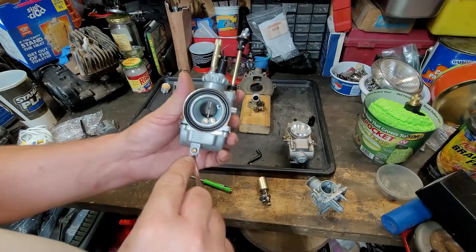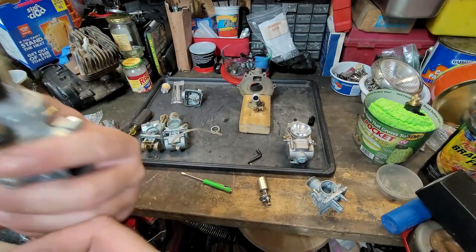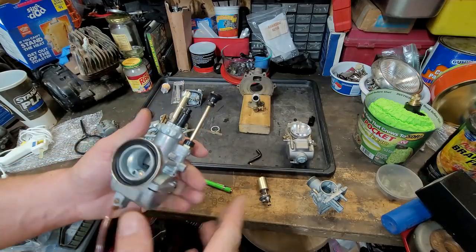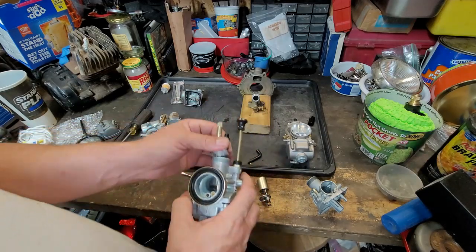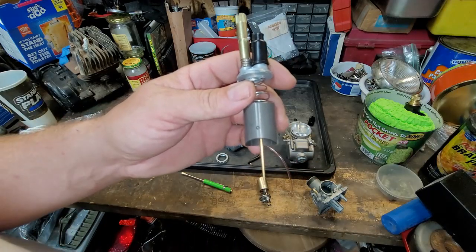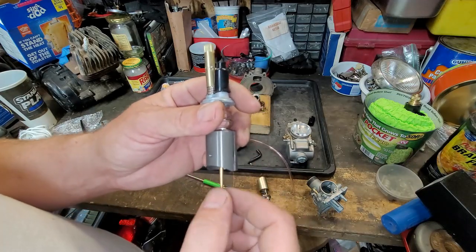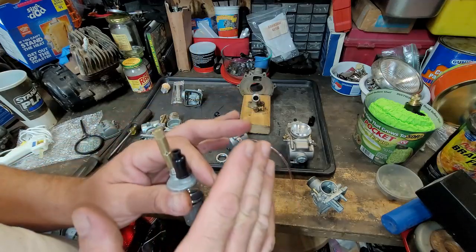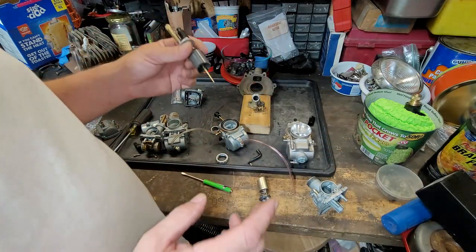One of the pros is we have a screw here to drain the carburetor bowl, which is really nice when you go to put these bikes away for the season. On my bikes I have to pull all the bowls down except for the KE-100 which has a modified bowl. Now let's take a look at the throttle slide — right off the bat I noticed that the taper of this needle is a lot thinner at the bottom than ours, more drastic than the KE-100. This is a nice performance needle. The thinner the needle at the bottom, the better the flow of fuel — if you can use a thinner needle, that's the way to go.